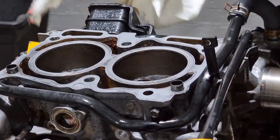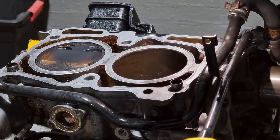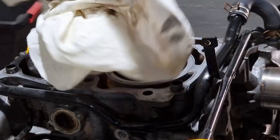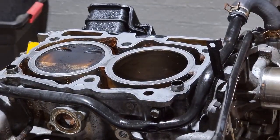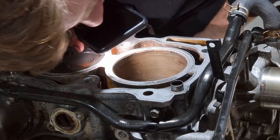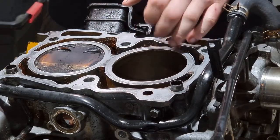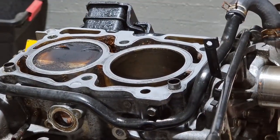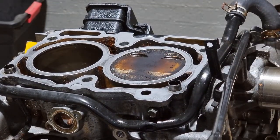This was very surprising — the pistons did not have much carbon on the tops. A very common occurrence for EJs is they carbon up very badly and you normally have to run upper engine cleaner through them at servicing just to remove all that. So the bores were very clean, still had the original hone mark in them with no scoring. This is a cross-hatch pattern that you can see inside the bores. There was a slight ridge at the top of the bores, but it wasn't anything to be worried about — that's just caused by where the piston goes to the top and kicks back down.